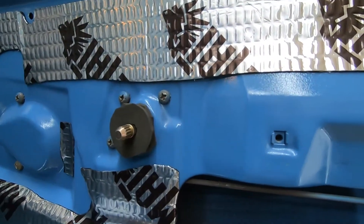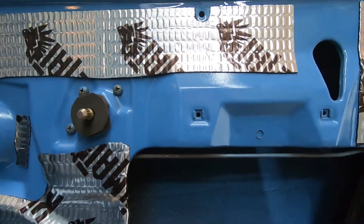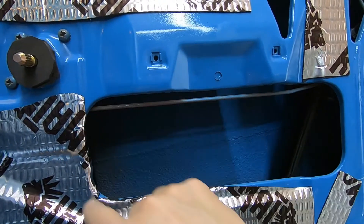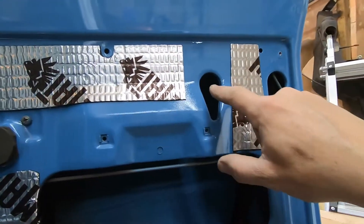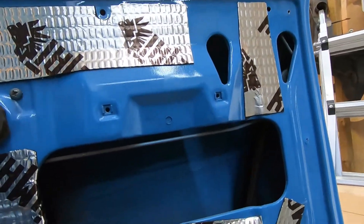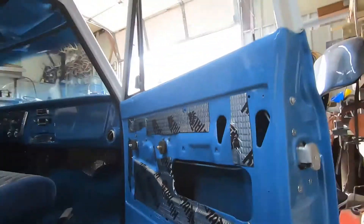So in the last few clips I've been building a little piece that looks kind of random, but I'm building a dust and moisture shield to fit in this hole on the door. You can see I've put the kill mat in here already to try to dampen some noise in the door. I am going to go ahead and cover these two holes up here — they're just for access for your handle bolts. I went through and hit every screw, every bolt inside of this thing, made sure it was all good and tight because I just don't know how much of this stuff I've tightened and how much I haven't, so I have to go back and check behind myself.